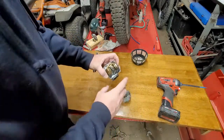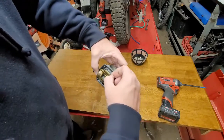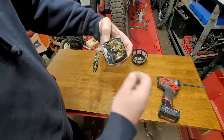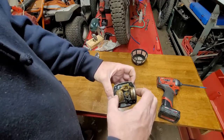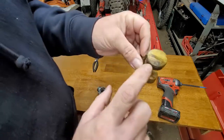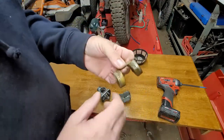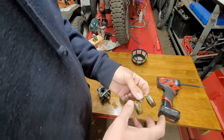You can see how nice and clean the bowl is. To release the pin, I'm just tapping on it and you can see the pin walking out. First thing you want to do when you take this off — since there was fuel in there — shake these and see if you can hear any fuel sloshing around. I call these pontoons. Make sure there's no leaks in there. You can also hold them underwater to see if air bubbles come up.